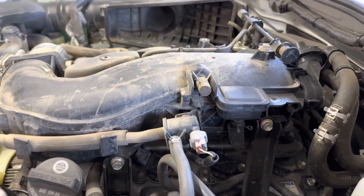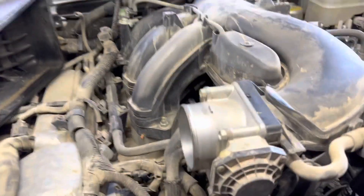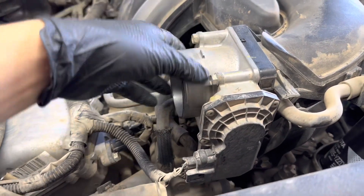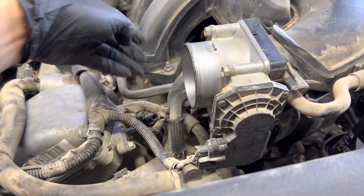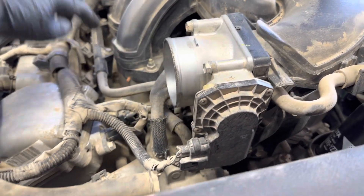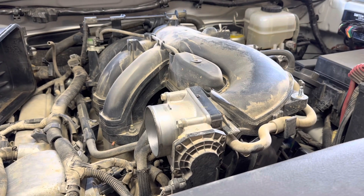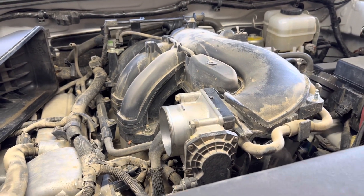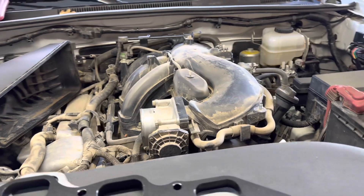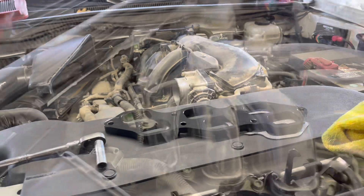Plugs and the three mounting brackets that secure it — remove all that stuff and it pops right off. I like to take the throttle body off and just let it sit here so you're not messing with the coolant that flows through it and having to bleed the cooling system. There's a gasket right here and right here — these are relatively new so I'm going to reuse them. Most of the time you can reuse them; you don't need new ones, though it's always good to have an extra set on hand.